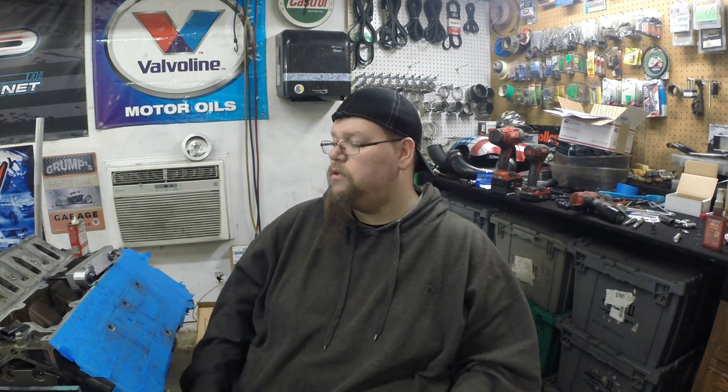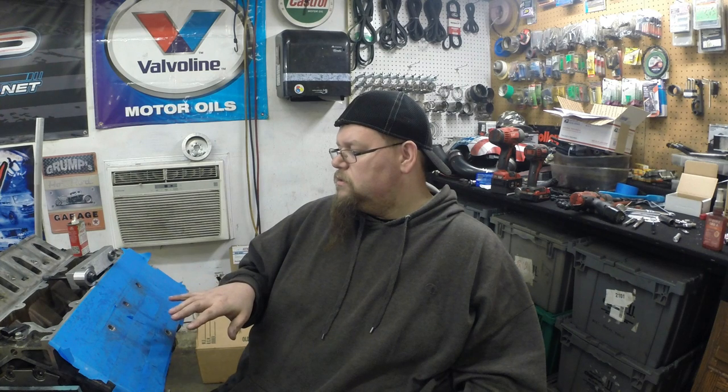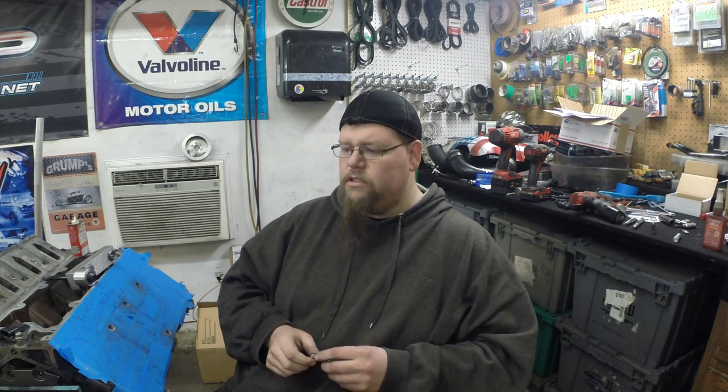I went ahead and ordered the kit. It's a little bit pricey, but it's going to be a heck of a lot cheaper than taking your engine to a machine shop. Basically, what I'm going to do is walk you through re-drilling a hole - I'll do one shallow hole and one deep hole. If you know anything about Gen 3 engines, you've got 10 head bolts on each side. All but two of them are deep holes, and two are shallow, so the shallow ones are more like a Gen 4 engine. This demonstration will be helpful for either one, which is why I'm doing one of each.